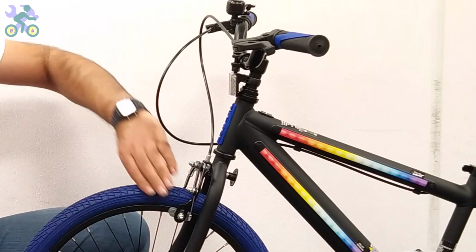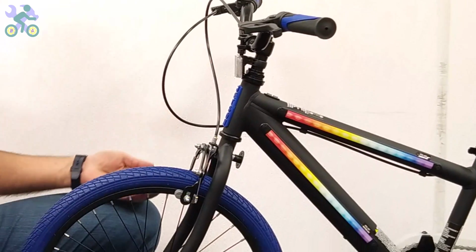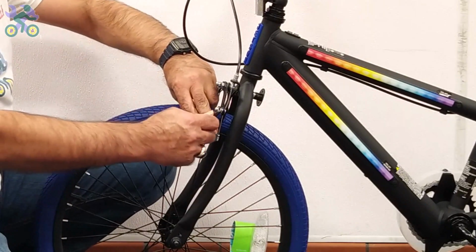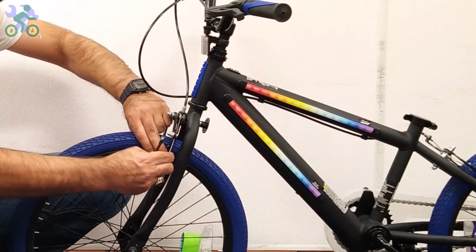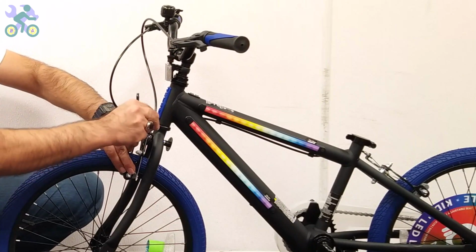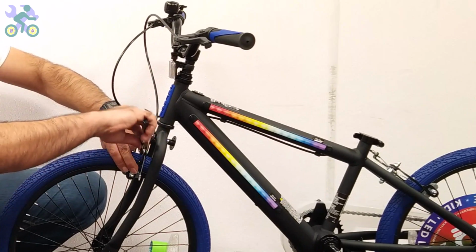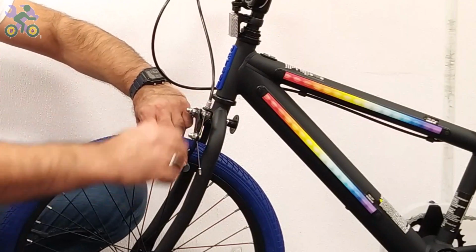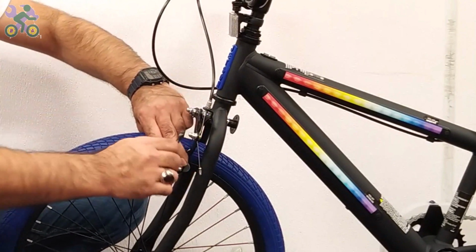To adjust the tension of the brake cable, press both brake arms with 2 fingers and loosen the anchor nut. If loosened, never mind. Make sure the top and bottom brake cover are in place. Pull the brake cable and then tighten the brake anchor nut.